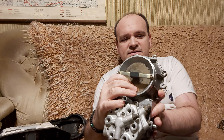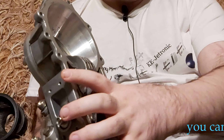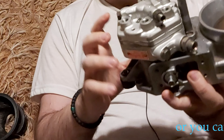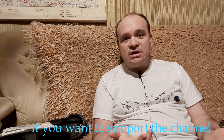That 1.9 mil clearance is the free play before the lever — this second part of it is the plunger — and the plunger opens the way for fuel up to the injectors, to flow to the cylinders. What I actually wanted to explain is how to adjust that.